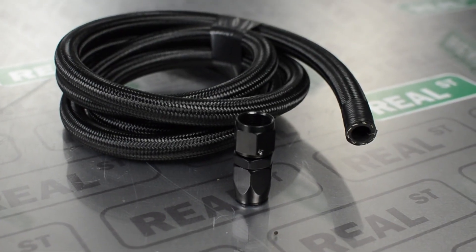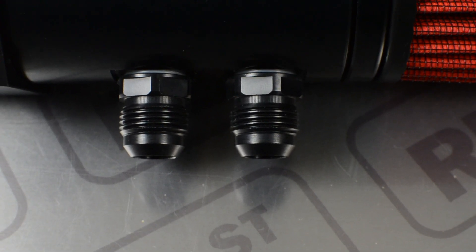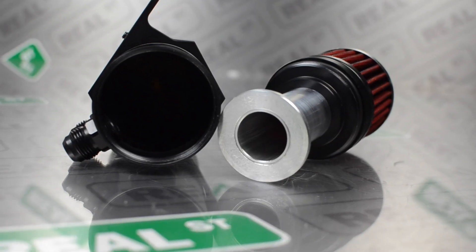This leaves the air to evacuate through the filter. It's also worth noting that these are dash-10 lines — I wouldn't use anything smaller than that. If you can go bigger, great. When you use a very small line, it doesn't allow the air to pass the oil as it's leaving the engine, and you can actually collect more oil leaving the engine with small lines than you would with a larger line.